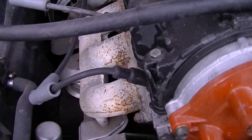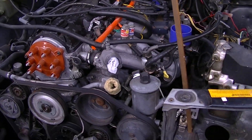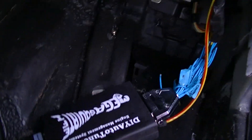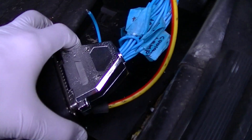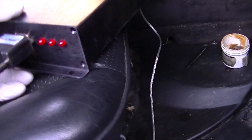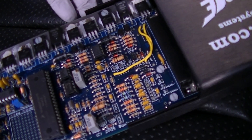I just have to figure out what's going on with the spark. I'm running the Megasquirt version 3 board, MS1. I pretty much took out any unnecessary components and replaced them with transistors to run higher amperage for the intake control valve, air control valve, and the injector driver.